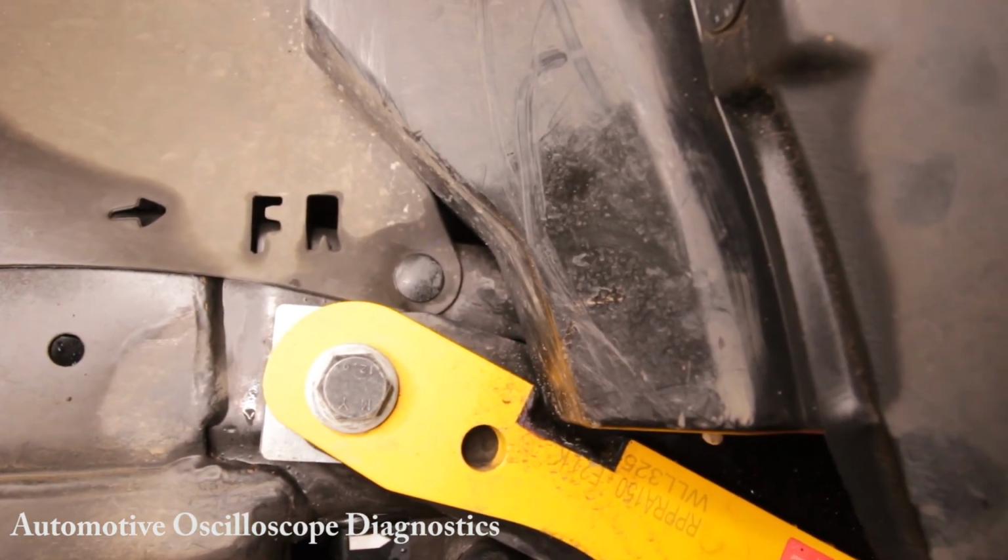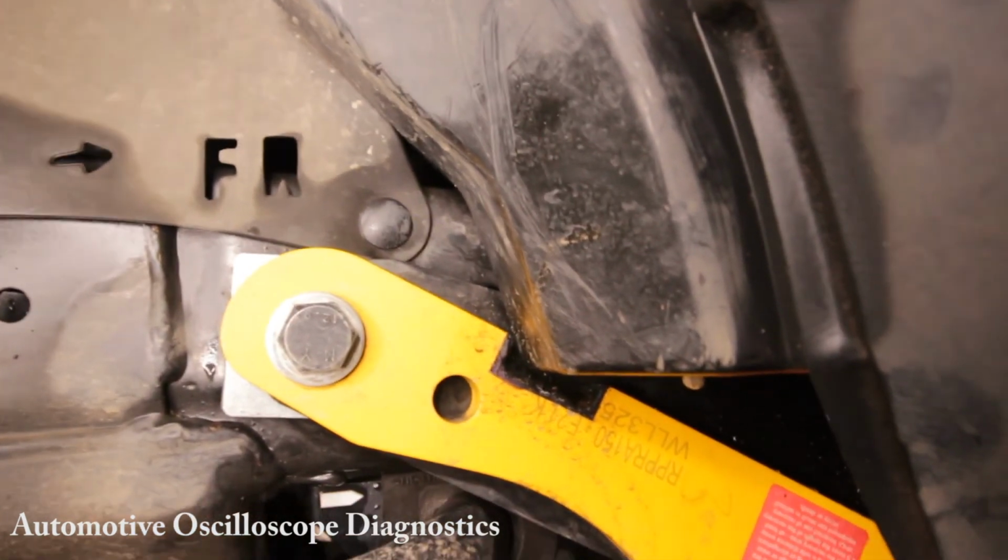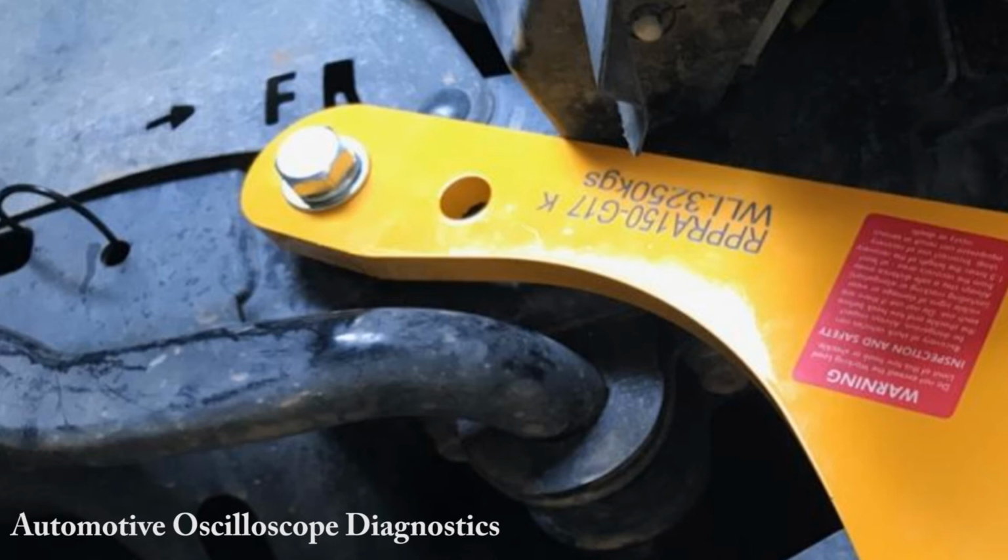But I'll just quickly attach a picture of something I found on the internet. I did find a picture of a recovery point installed to a Prado 150 that's had an ARB bull bar. And have a look at this. From what I can see, that recovery point is hard up against the washer bottle. Obviously they've also installed washers like I have between the recovery point and the chassis, to keep that recovery point parallel to the chassis. So that's obviously something that you need to do on these cars. There's no other way around that.